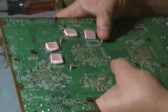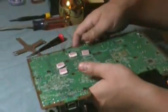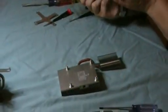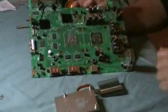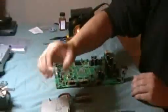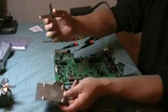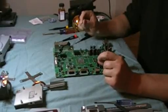You don't want to use a lot of pressure to push. That grease on there is actually fairly sticky, so you just want to use pressure from your hands and wiggle it off. Look at all the grease on there. So you'll see here the graphics processing unit. The next step is now that we've removed these — they're not screwed down, it's just a clamp. That's the only thing holding the pressure, which is kind of suspect as well. Some people use little M5 screws and tighten it themselves without over-tightening.